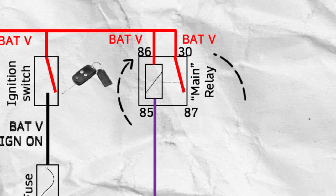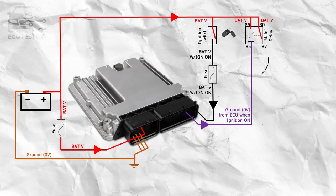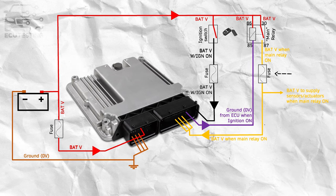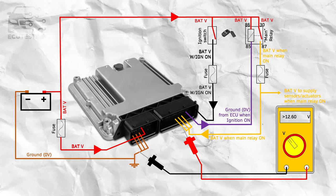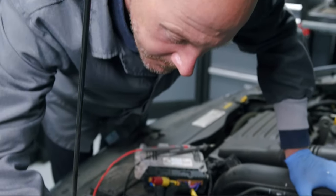Assuming there is a good battery voltage supply at relay coil contact 86 and the common contact 30, this switched ground zero volt output from the ECU to coil contact 85 will cause common contact 30 to short the normally open relay contact 87. It is then supplied back to the ECU through a fuse, sometimes on thicker or multiple wires for higher current handling capacity. This voltage is also used to supply power to various engine-related sensors and actuators. Using the multimeter, check all points where the main relay supplies positive battery voltage. If this voltage doesn't exist, check the main relay itself, the fuses, and the relevant wiring. If a lower voltage is present than the battery supply, this may indicate a wiring fault or a faulty sensor or actuator pulling the voltage down.